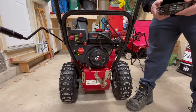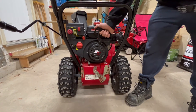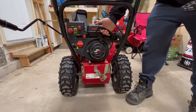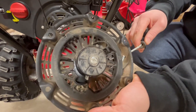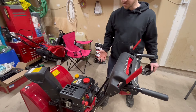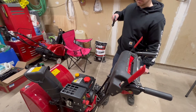Another way to help your recoil last longer: when you initially go to pull it over, don't jar it into the flywheel receiver. You want to rest it on the flywheel, then pull it. Because when you pull it over, these pins come out into the flywheel receiver and they slam against the engine. Another thing you don't want to do — no matter what size the engine is — you never want to max the rope all the way out to the stopper.